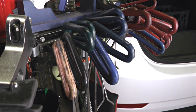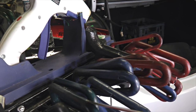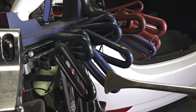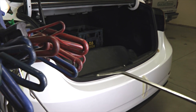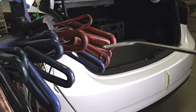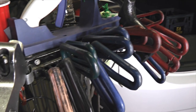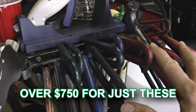These right here are just the small open spots where we only have a couple of dents. Now I want to show you some of the hail dent removal tools that I'll actually be using to repair this. I've got quite a few different tools — not just one tool is going to pop out all the hail dents. These are all small and skinny. We've got a tool here which we call a whale tail; this is great for sliding in above the bracing. These other tools are great for getting up inside the opening holes to push on the dents. Most of these tools average anywhere from about $30 to $100 per tool, so you're looking at probably a few hundred dollars worth of tools just to fix the hail damage.